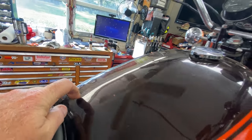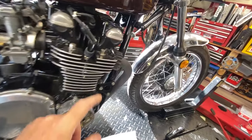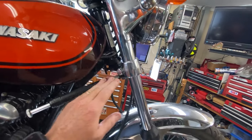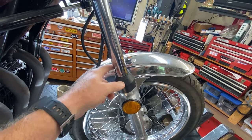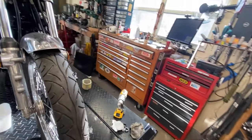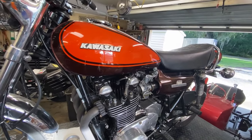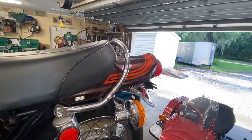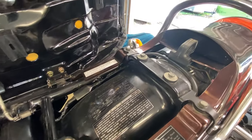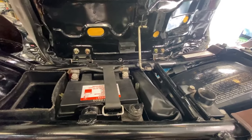Paint is starting to blister but overall the bike is in pretty good shape. The side covers have typical stress cracking, a little chip on the engine paint, and some surface rust that'll clean up with steel wool and WD-40. The forks are leaking — especially the left one — so they need to be rebuilt. The stickers are in immaculate condition under the seat.